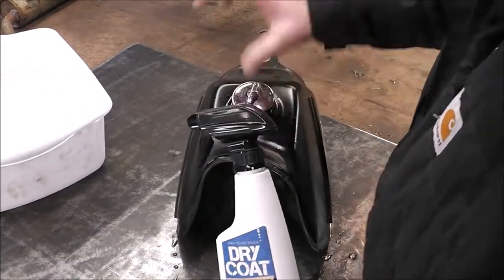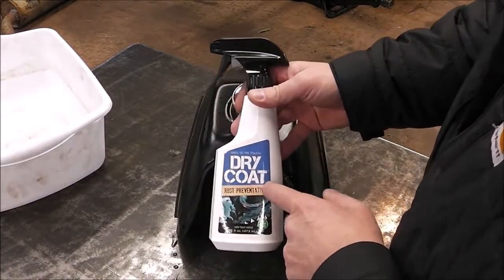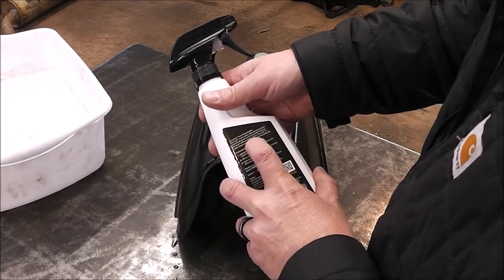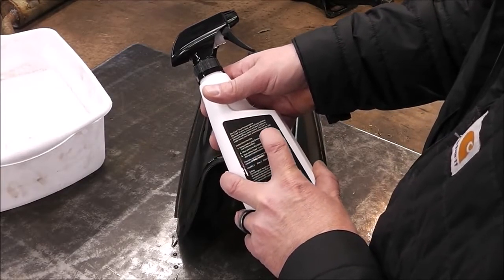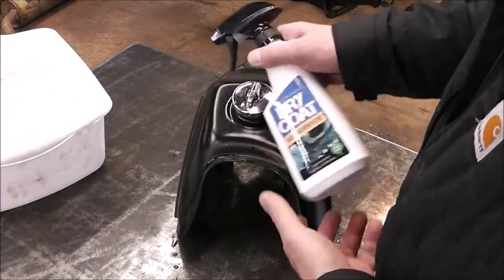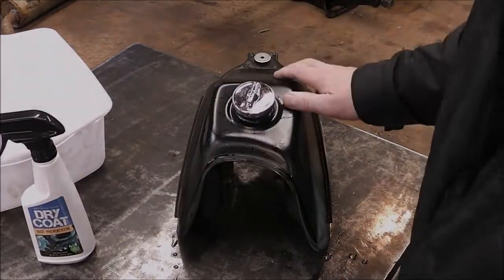When it's all said and done, after this sits a little bit longer, I'm going to rinse it out and flush the tank, then spray some of this Dry Coat in it. Dry Coat is a clean, safe, easy-to-use solution preventing rust on iron and steel. It dries to the touch without sticky residue, it's water-based, non-toxic, and environmentally safe. I'm just going to squirt the inside of this so that while it sits empty and dry, it doesn't rust up on us before we get to put it back in the project. And that's all there is to it, guys. Thank you for watching. If you want to find out what I'm doing before it even makes it up to YouTube, you can check me out on Facebook and Instagram. If you like this, please don't forget to rate, comment, and subscribe. Until next week — I'll see you then, stay safe, have a good day.